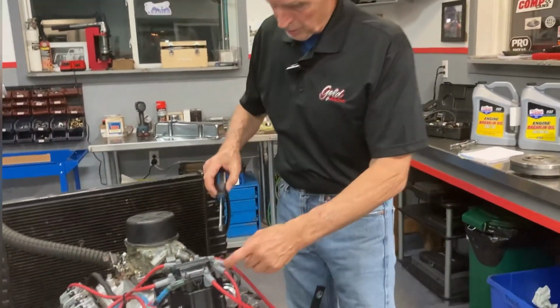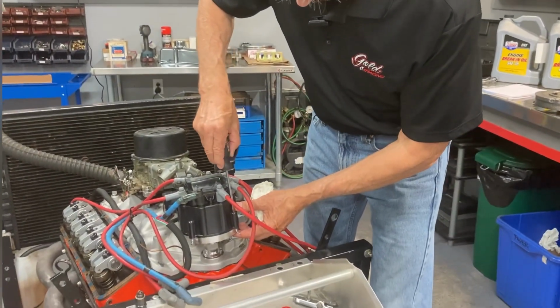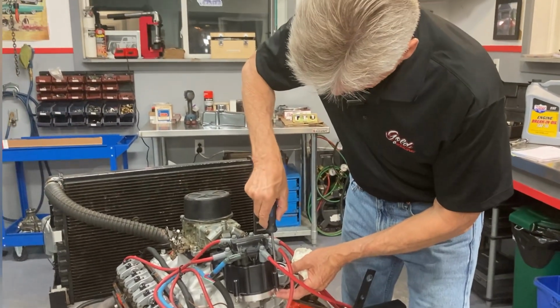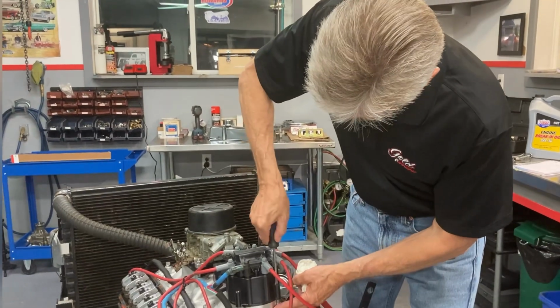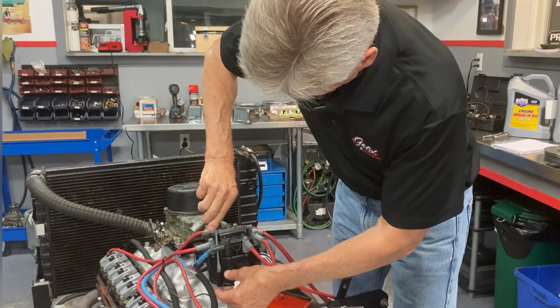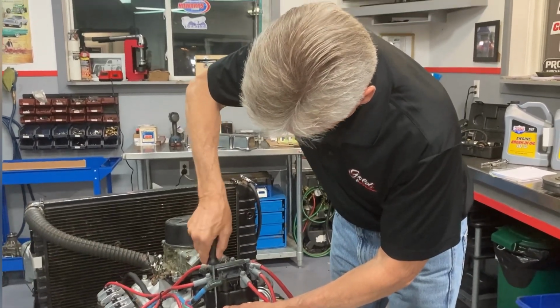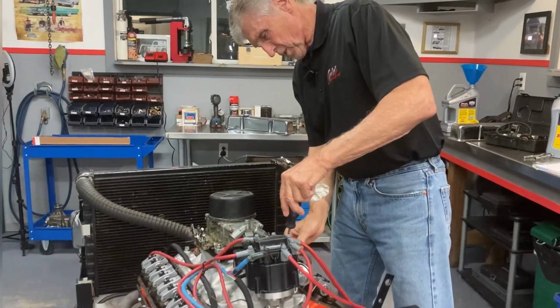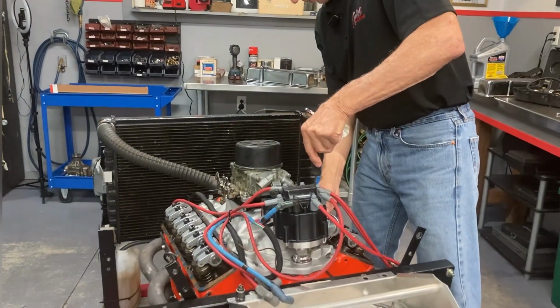So now I know that the rotor is over here. Once you determine that, you could start anywhere. You don't have to start at number 1. Okay? And for purposes of checking valves, all we're doing is making sure that when we're adjusting the valve, the camshaft is on the base circle. And I'm going to show you that in a little display here in a second.